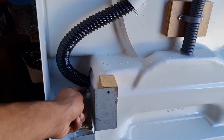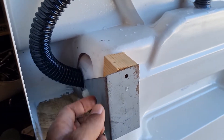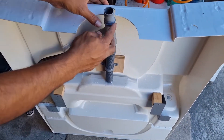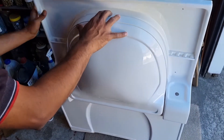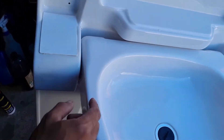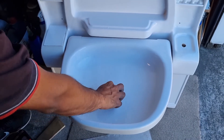Another thing to note: make sure that when you pour water in the sink, water doesn't come out of the gap here. If that happens, it means the drain is not attached to the holes in the sink. I've made another video about that and the link will be below. If you pour water in here and you see water coming out the side, that means the black pipe I just showed you is not connected — it's come out from over here. Watch the other video for more on that.